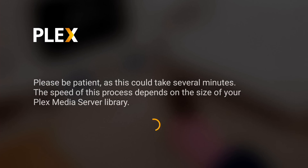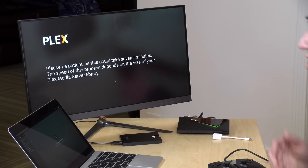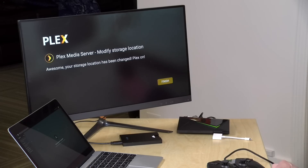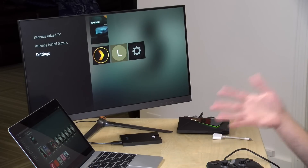This will take a second or two. What it's going to do is dump out that database and store it now on the external storage. This doesn't move everything over — I found that when syncing things for download, doing offline viewing, it was still storing the transcoded media on internal storage. But browsing the drive, it is moving a lot of the metadata and all the database content over there, which will certainly help you manage storage over time. And it looks like we're already done — I'll click Finish. It's going to reboot the Plex server quickly, so you'll see it drop offline briefly, but it'll come back up very quickly.